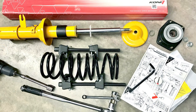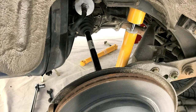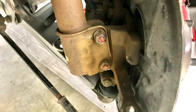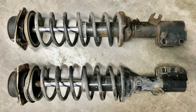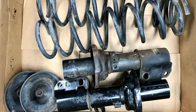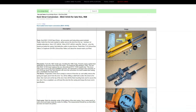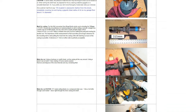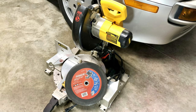Not long after, I decided to replace the front shocks with some Koni Sport adjustable units to match the ones in the rear that I had replaced the year before. The front end was a little springy, so it was clear that the old shocks were starting to fail. This car came with sealed struts up front that require the entire assembly to be replaced, but since the Koni sealed struts are no longer in production, a front strut conversion was the way to go. This allows replacement strut cartridges or inserts to be used with the existing strut housing and involves drilling some holes to drain the old shock oil and then cutting off the top of the strut housing. I elected to use a metal cutting wheel on a miter saw for a nice clean cut across the top.